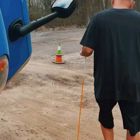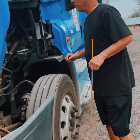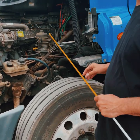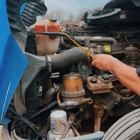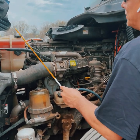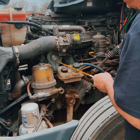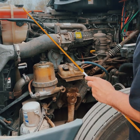Moving to the driver's side, I use a 2474 system grouped into four parts. The first two: cooling reservoir — securely mounted, not cracked or broken, not leaking, filled to its proper level, cap on tight. Water pump — securely mounted, not cracked or broken, not leaking, belt-driven, no more than three-quarters of an inch of play in the belt. Coolant runs through the water pump, so those go together. That's your two.